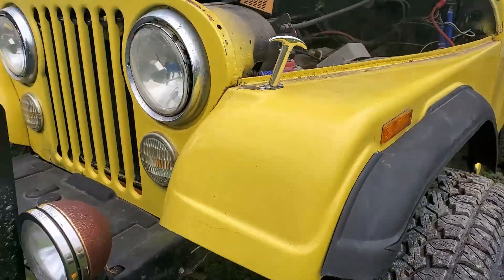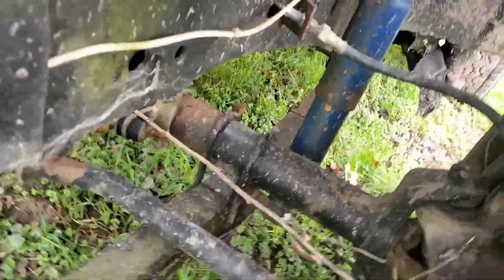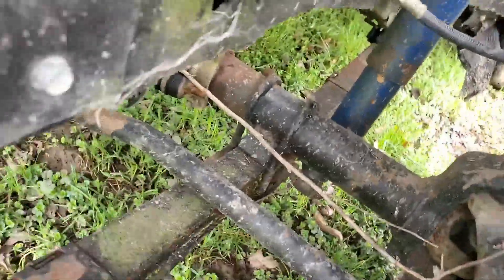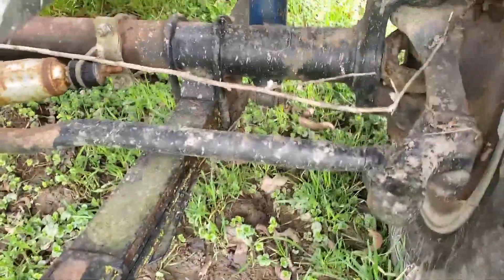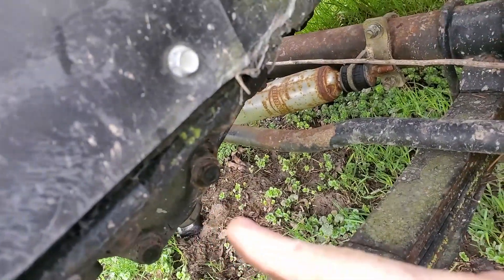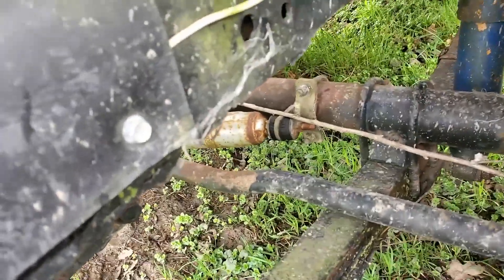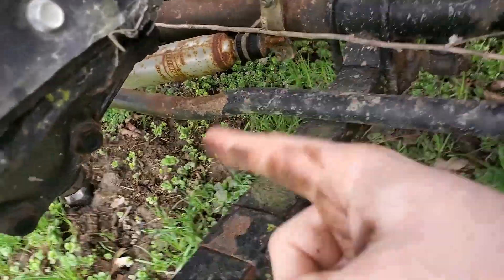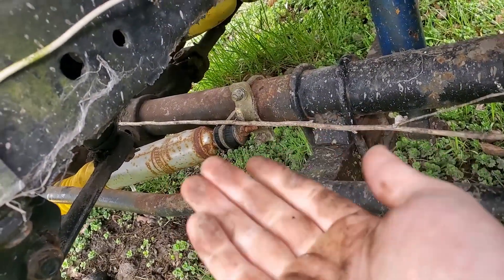You need to do this when you're going through trying to diagnose stuff, because it could be tie rod ends. But you see that that movement's not in there — not that I could really move this too easy because it's in the mud right now. This is kind of the way you need to diagnose this. You have slop in the steering wheel, follow it down — that slop ends right here, at least for right now. So we know that we have that much slop in that steering box. Now if the steering box was tight and we have movement down towards where the tie rods start, then we can look there and see where the slop's at. But right now we know it's in the steering box.